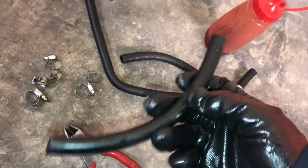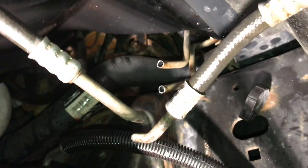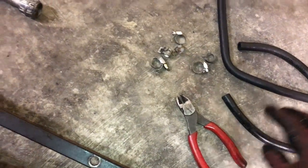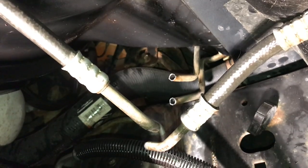So what I'm going to do is cut the lines off — as you can see here I cleaned them up, deburred them, cleaned them out so we've got nice smooth surfaces. I'm going to take some rubber hose and clamps and just reconnect these cooler lines. The transmission cooler lines are not under much pressure, but they do go through a lot of temperature changes, so I want to make sure they're tight. I'll use multiple clamps per end and plenty of rubber hose over the steel lines. It'll be cheaper and faster — I don't have to go get a part.